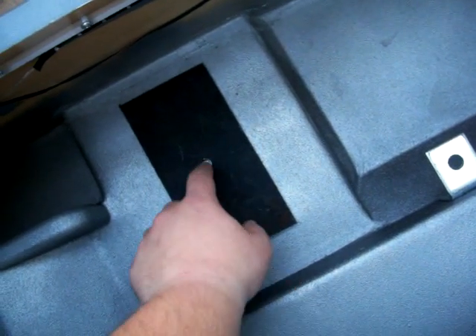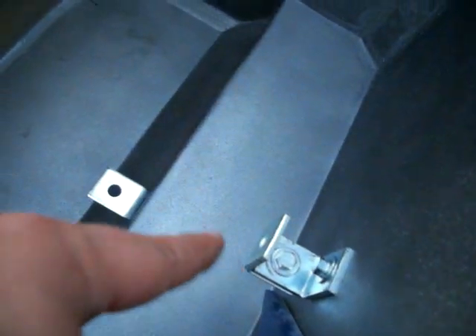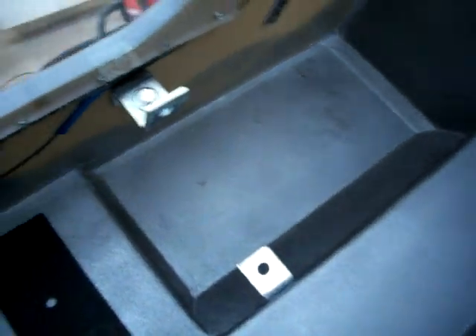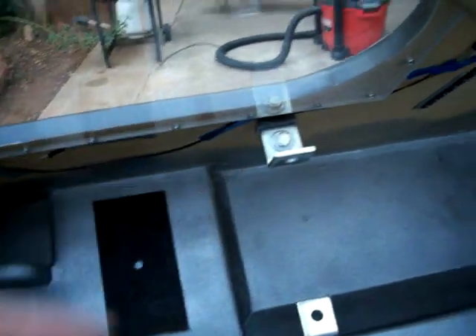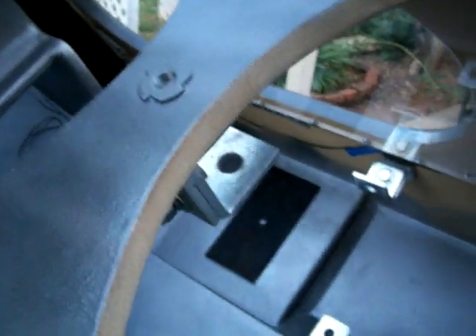This bottom bracket is 3/16-inch thick steel. It's gonna have a half-inch deadbolt straight through my cab. As for these brackets right here — quarter-inch thick steel brackets — basically bolted to my box. Gonna have half-inch all-thread going from here down to there and then to there. So it'll keep the top and bottom from flexing. It's one-inch thick MDF so it shouldn't flex, but just in case — a box that doesn't flex is a more efficient box. The reason it's not quite in the center of the box is because I took a dimension from the port wall to that wall and cut it in half, so from the port to the end wall this is dead center. I just wanted to add a little more support to the center of the box since it's only two and a half inches by one-inch thick wood. I've banged on it and it doesn't flex, but you know.